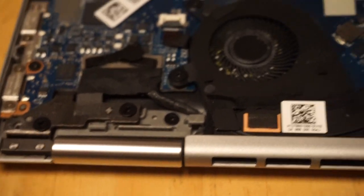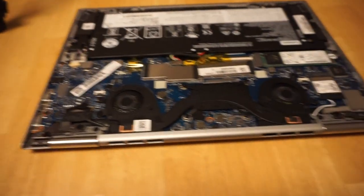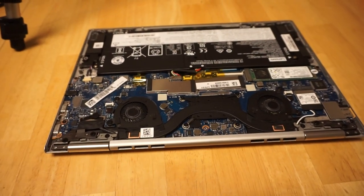So I gently pulled it loose so that there is some slack now as the screen rotates. And I have had zero issues with screen flickering. The laptop went from completely unusable to behaving amazingly just by adjusting the routing of that cable.